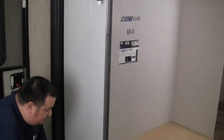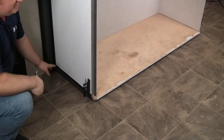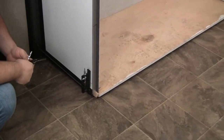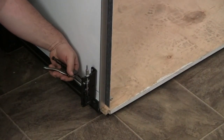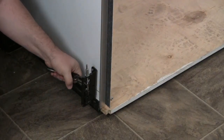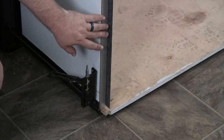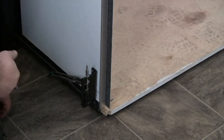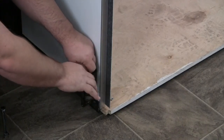Take note that when you're tightening this interior bottom cable, not only are you tightening the cable, but you're going to be tightening the chain and your exterior top cable at the same time. We're going to clamp on the cable on the back side here. This is an example that with the fascia on, you can still make this adjustment. We're going to tighten this adjustment nut.